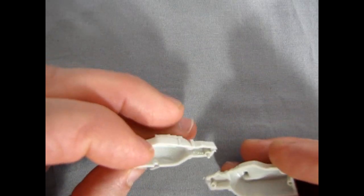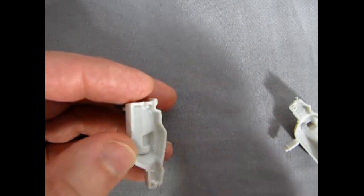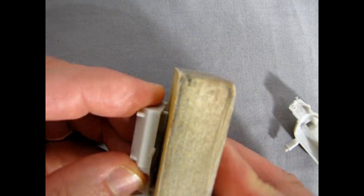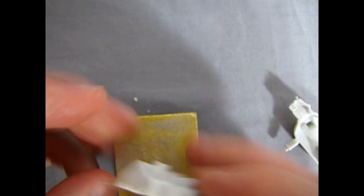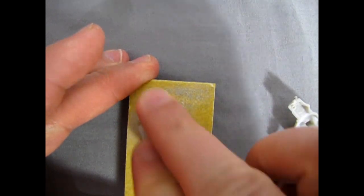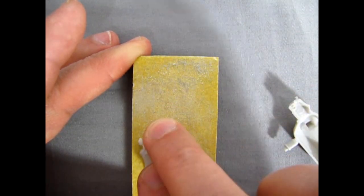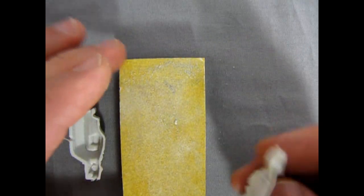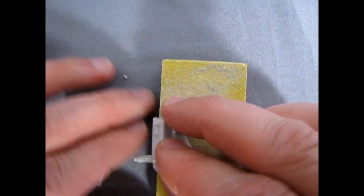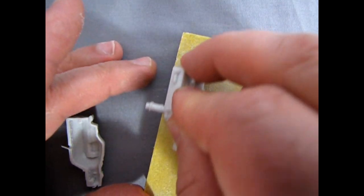So following an old suggestion from my uncle way back in the 1980s, he says to get rid of these alignment pins, and we can do that with our sanding block just by sanding them basically off until we get this nice and flush on our engine. Now remember, you're cross sanding, so 1, 2, and then this way. That's to make it nice and flat on this edge. And then I'll also do the same over here. Just be careful of that magneto there. Seems to like that.